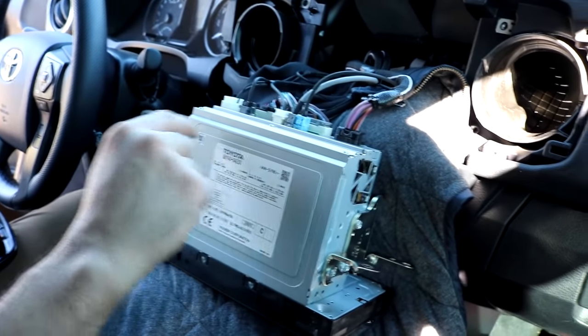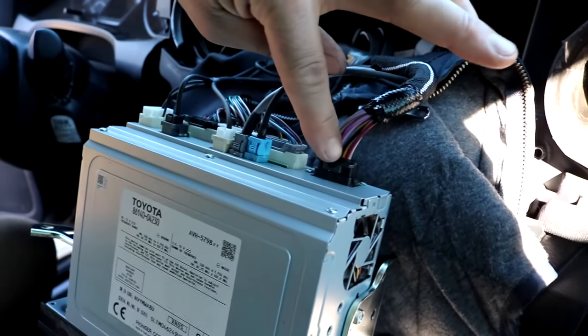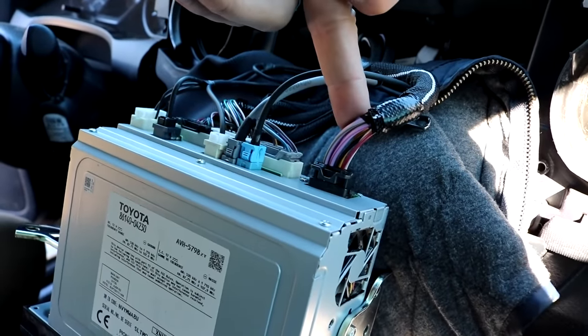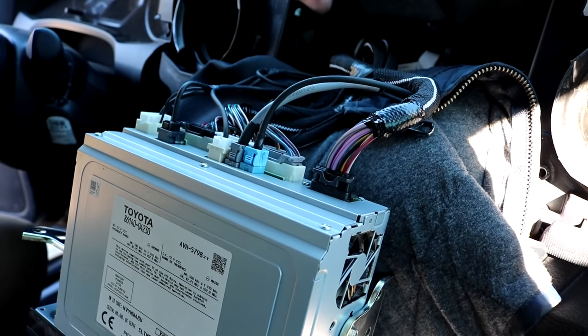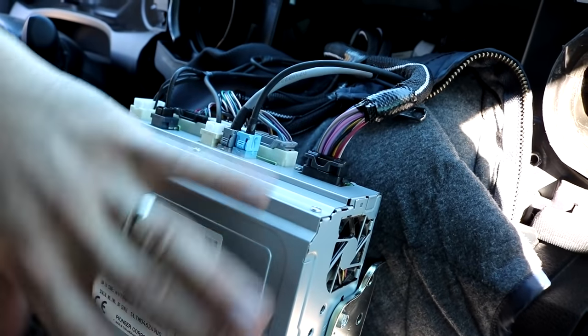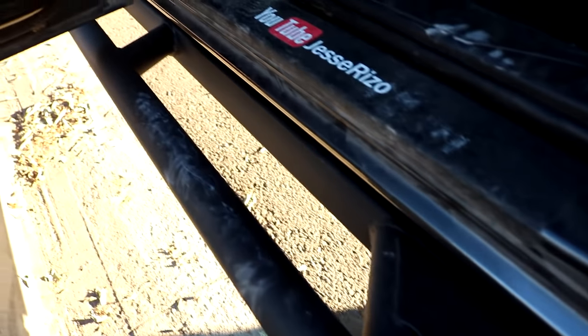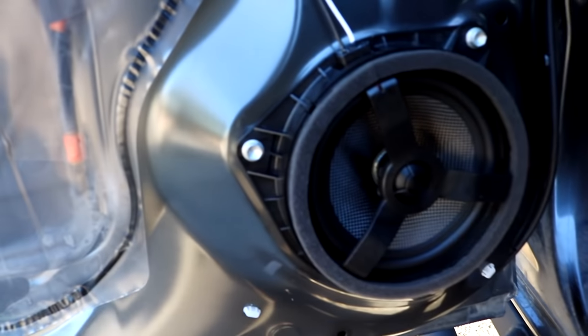With the 2020 head unit, you're only interfacing with this 10-pin black connector. This is a factory 10-pin. This has the front and rear channels allocated to it. And that's really all the OEM Audio Plus system is doing, is hijacking all the factory signal. So we're acting as a true middleman, amplifying and remastering everything as it pertains to sound reproduction. Everything that you hear from the speaker locations has gone through the amplifier and digital signal processor, remastering everything.